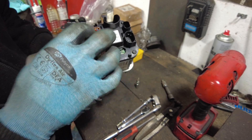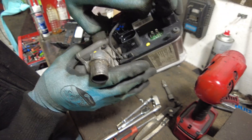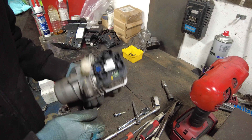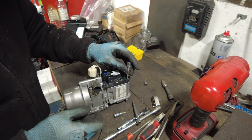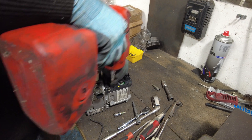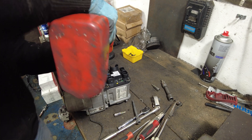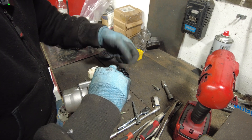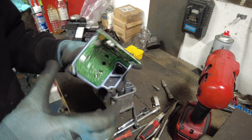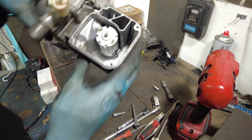Just squeeze these two tabs on either side of this plug. This is the coolant temp sensor wiring. The ECU is held on by four T15 screws. The ECU pulls off, and then inside there you have the motor for the fan.